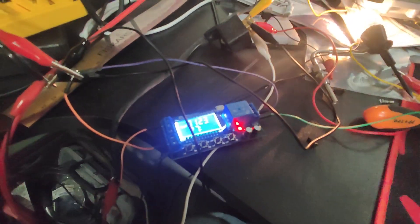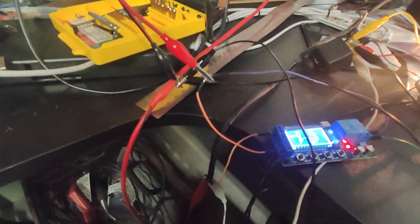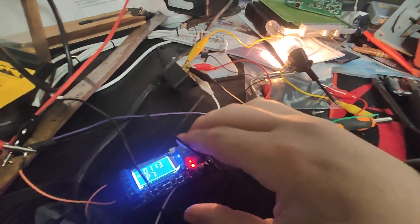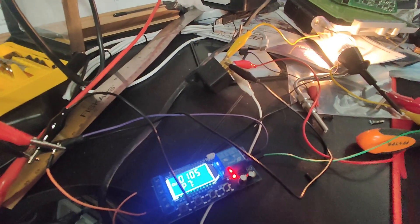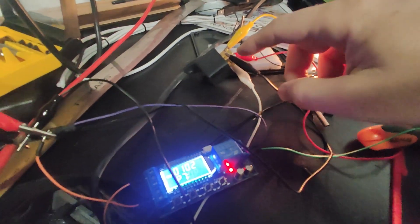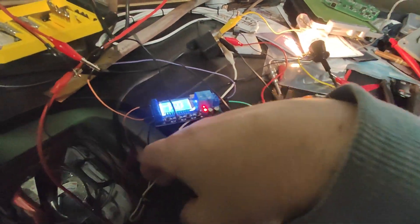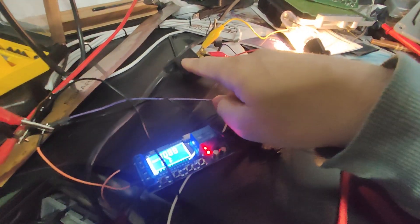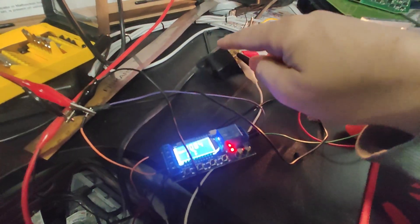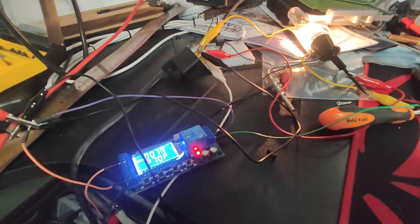When I turn the power off, the light turns on and it starts counting down — 126, 125, etc. This thing keeps power on while power is attached, but you don't want your courtesy lights on while you're driving. So I added a relay running in normally-closed mode. While the power is on, the relay is open so the light isn't on, and when you turn the power off, it feeds power to the light through the normally-closed relay — which does exactly what I wanted.